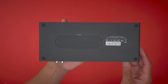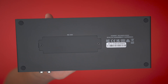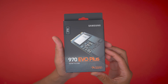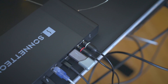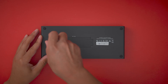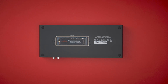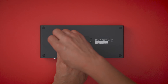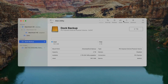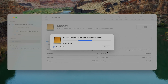M.2 NVMe SSD. On the bottom of the Thunderbolt 4 SuperDock, you'll find an SSD cover plate that hides the M.2 NVMe 2280 PCIe SSD socket. Users can supply their own M.2 SSD, such as the popular Samsung 970 EVO+. The dock supports SSDs up to 8TB, and a full list of compatible drives is on Sonnet's website. Installation is simple: remove the cover plate screws and standoff screw, insert the SSD, reinstall the standoff screw to secure the drive, remove the plastic sheet covering the thermal transfer pad on the cover plate, then reinstall the cover plate. Once connected to your Mac, macOS will recognize the SSD. You can also use Disk Utility to manage or format the drive, or even install macOS onto it and use it as a boot drive.